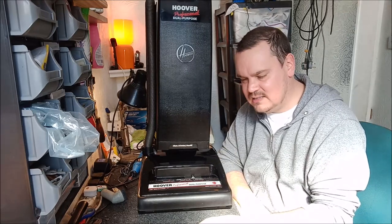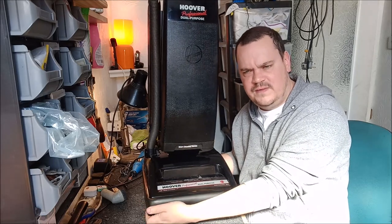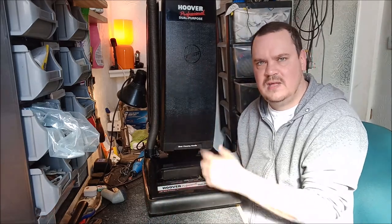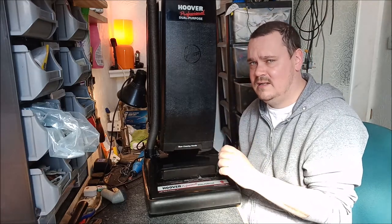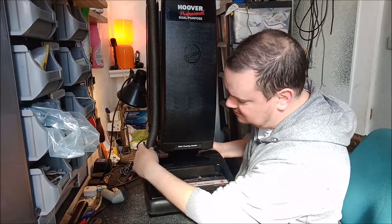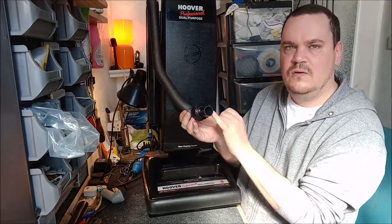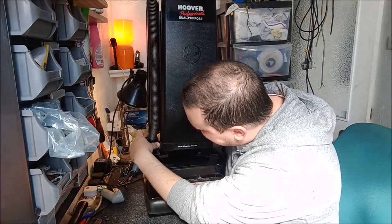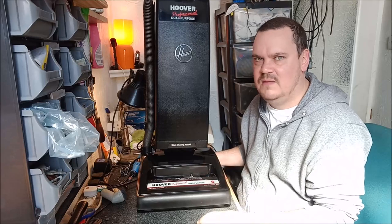Still, the tool suction is just rubbish. Whilst the machine's running, if you hold your hand under here — don't stick it in there because the brush roll's there and you'll lose your fingers — you can feel a lot of airflow. There is a massive amount of airflow at that point, but by the time it's routed through that little tiny hose — the internal diameter of the hose is really tiny, like one and a half centimetres. It looks thicker from the outside but the inside dimension and how it joins to the machine end restricts the diameter. So I'm not going to be too mean to it — it's not brilliant, you can use it to do your dusting, that's about it.